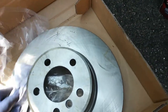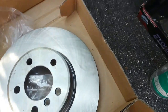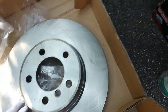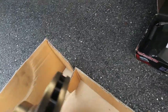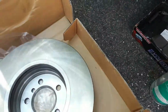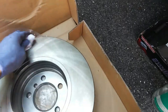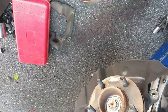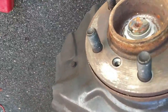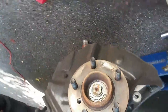Now we're going to get our rotors cleaned up. These rotors usually have an oily film on them to keep them from rusting, because they're shipped from different places and can be in a damp shipping area where they could get rust. So they put oil on there to protect it. Now putting in the new rotor, you want to make sure that the hole that holds the rotor to the bearing is lined up.